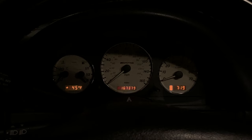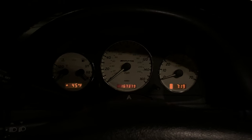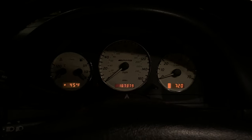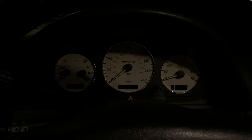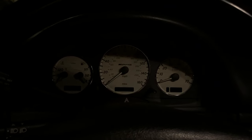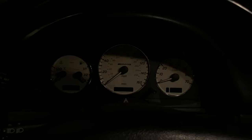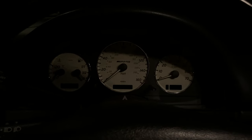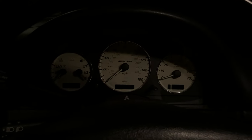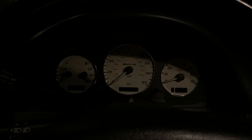I'm hoping somebody watching might know what this could be. From researching online, the only possibilities I can think of would be the all activity module, or something to do with that system going wrong. I checked most of the relays and fuses. I thought it might have been the brake light switch, which I replaced because around the same time this first started happening, a headlight went out and the brake lights were failing. I replaced all those and replaced the brake light switch, but that unfortunately wasn't the fix.